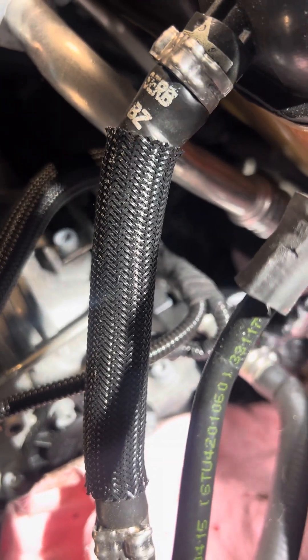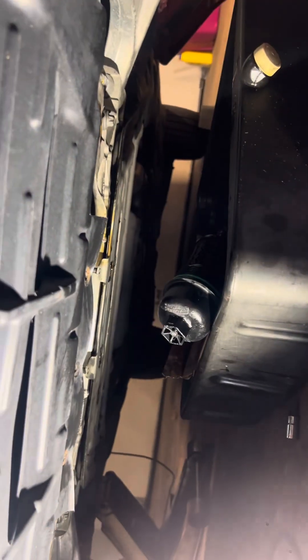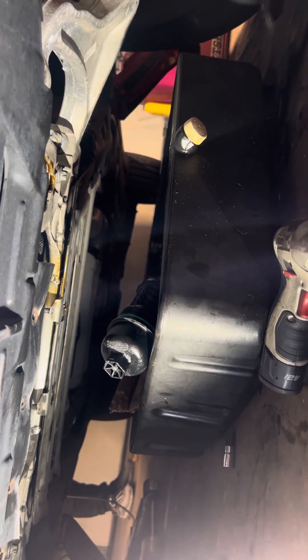After you're done with the oil filter, come down here at the bottom and remove the heat shield. I already removed the heat shield. You'll need an oil pan down there to catch the oil, and also a 10 millimeter socket to remove the drain plug and get the oil out.